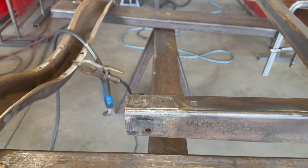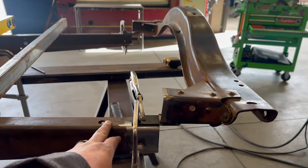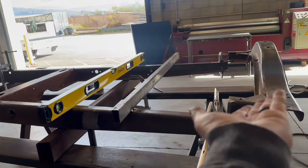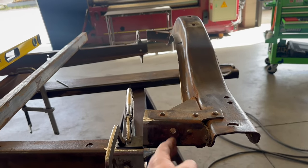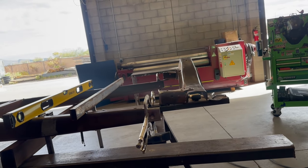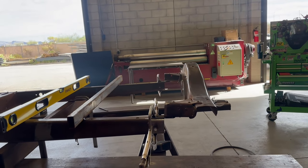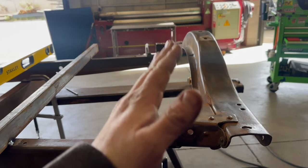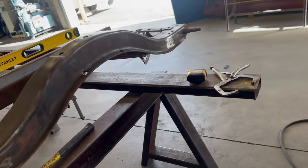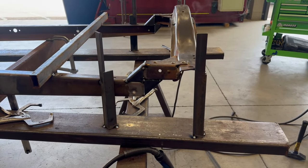I cut the back crossmember off and prepped the frame a little bit. I'm scrapping the idea of clamping it flat to the top surface because the bottom flat kicks up and is tacked to an angle — this is still tapered while the other piece is flat, so it kicks it back. It's clearly sloped. I might still use this idea to help keep it clamped, but I'm going to have to bend this thing up.